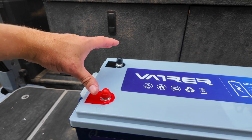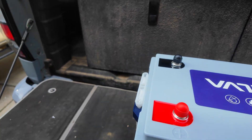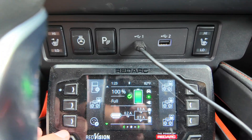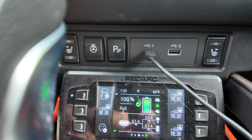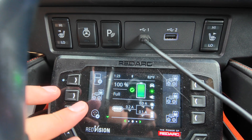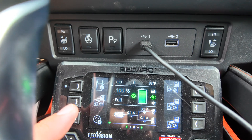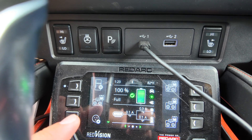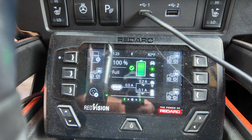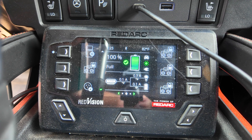The nice thing about this being a house-style battery with just positive and negative posts is you can hook it up to basically any control system you want. I use a RedArc system for my power needs — you just tell it it's a 200 amp hour battery, and it knows what to charge it to. It can monitor solar input, shore power, or alternator output and keep the battery topped off. You don't have to go with RedArc — it is really expensive. Kick-Ass, Renogy, and even Garmin have options. I'll put links in the description.